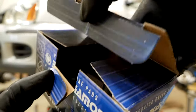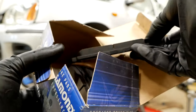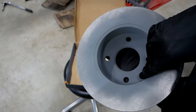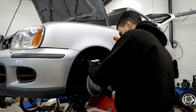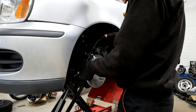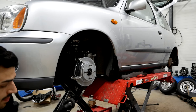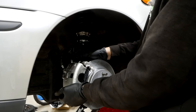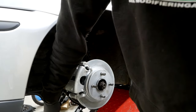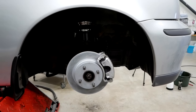I went with a set of pads that can handle both the streets and the track, so it's a good compromise and we'll just have to see how it holds up for some track abuse. I spray painted the brake rotors just to postpone any rusting, and the overlapping paint that you can see on the friction surface — that little bit right there — is going to get scraped off as soon as you apply the brakes. And there we have it, all new brakes in the front, so let's move along and fit the BBS wheels to the car.